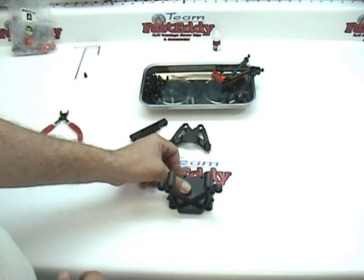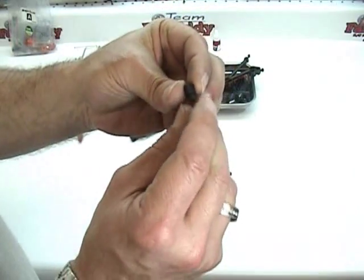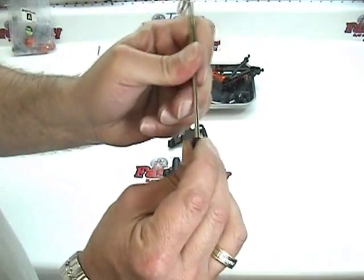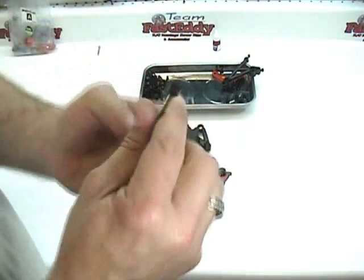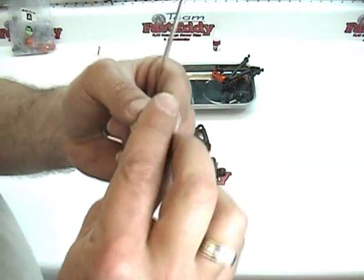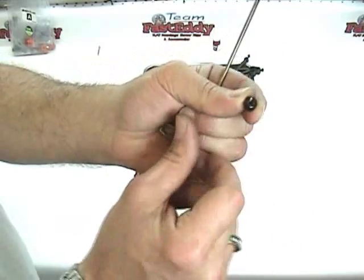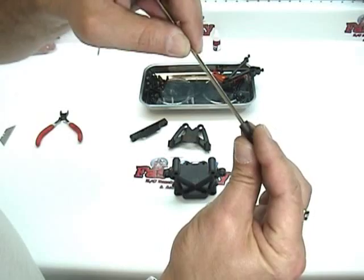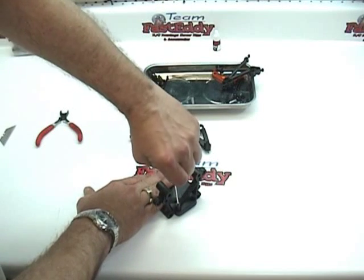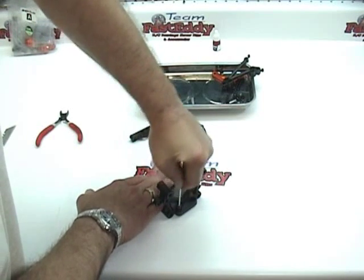Very simple to get them in — there are several different ways you can do it. As we showed before, this tool called tool 85459 is a little lock nut installation tool. We're going to put our 3mm wrench into the hex portion and push it onto our wrench. There's a little nut that sticks off here. We're going to grab one of our M5 nuts, take the ridged portion of the nut and insert the tool into the ridged portion like so, then line the nut up with the hole in the brace where it belongs and push it in until it's seated.